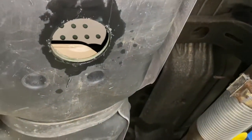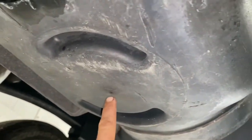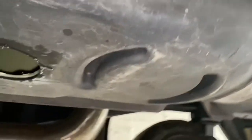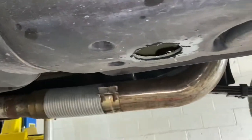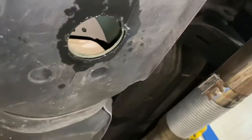Here you go — there's the front of the truck. Come up through our little hole here and you guys can see that little tank divider screen, filter, whatever you want to call it. Look back this way and there's our factory sending unit. You do not want to plug right here below the sending unit — it's liable to mess up fuel flow, and this is actually more the center of the tank anyway. Tanks are just about different between every year model, so do your research and use your due diligence.